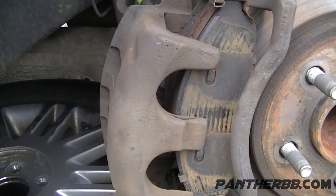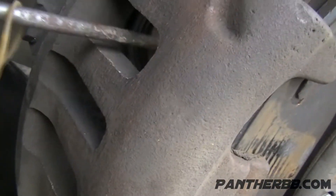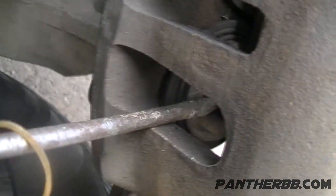In most cases you may come up with a situation where the caliper does not want to come off. It's not the proper way to do it but you kind of get it in between the piston here and here and you kind of squeeze back on it — top and bottom.